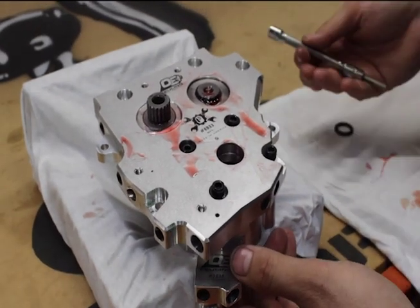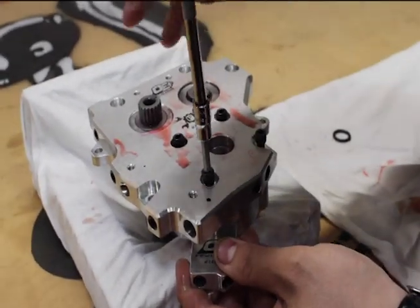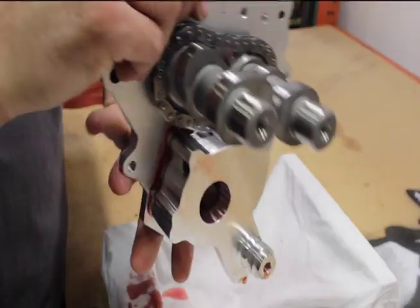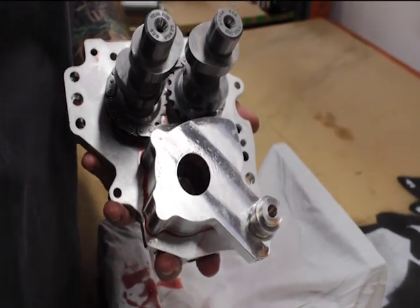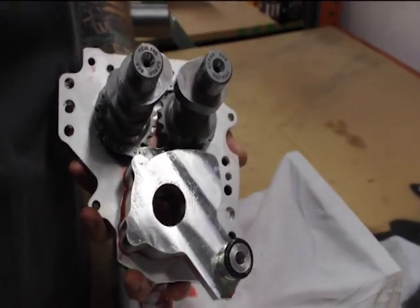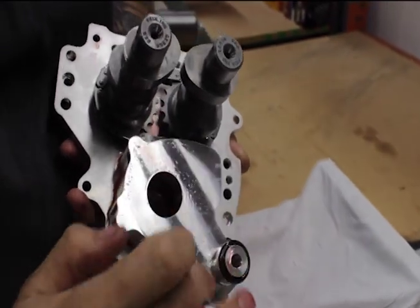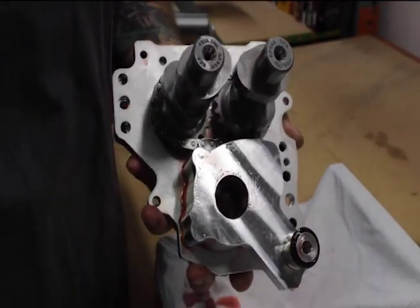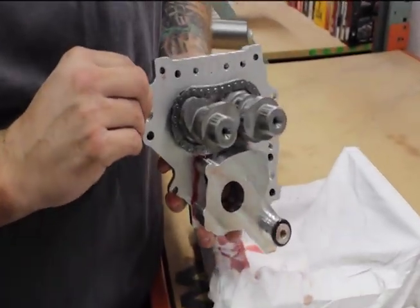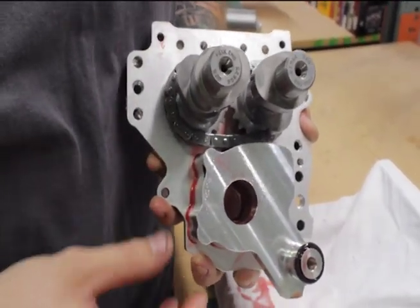With our oiling system, we recommend against using any Loctite whatsoever. The reason is that Loctite can actually cause issues with stack-up tolerance, especially with a performance oil pump like this. And if used excessively, it can cause Loctite debris to go into the oiling system, which can lead to pump failure. The next key component when installing our oiling system is that this O-ring actually needs to go onto the back of the sub seal first before we install it into the case. Put just a little bit of assembly lube to help guide that O-ring in and prevent it from tearing or getting pinched. This ensures that when we go through our torquing procedure, the pump is not going to come dislodged from that O-ring, which could potentially cause scavenging issues.